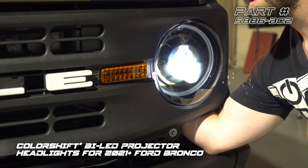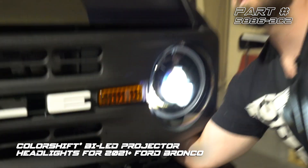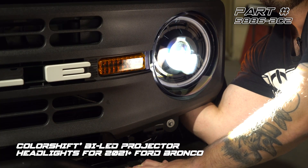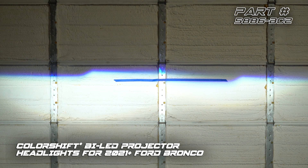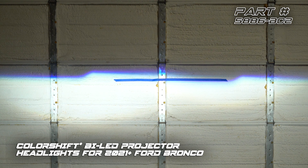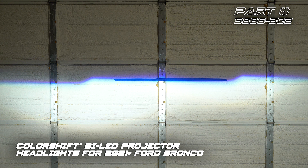With the lower trim removed, we can access the back of both headlights. You're going to reach in here and feel for the rubber cap in the center of the headlight, remove that, and take our supplied Allen tool to fit it in the bolt. The driver's side is a little high, so we need that to come down — we're going to turn our bolt slightly clockwise just until we get our center cutoff line to meet the tape. We're going to put our cap back on and move over to the other side. The passenger side headlight is a little low, so we're going to move that one up slightly.